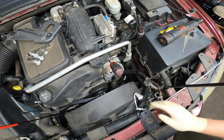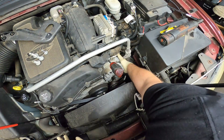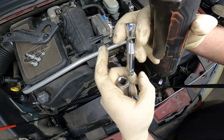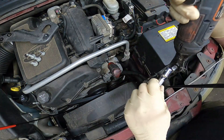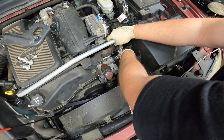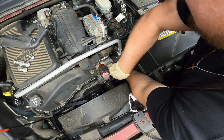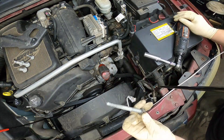My next question is how many bolts are underneath, because it would be pretty cool if it was just one. I think it is just one bolt down below. What I think is going to help me access that lower bolt is this 3-inch extension with a 5-degree swivel head on it — that allows the head to rotate or wiggle just a little bit. Alright, lower bolt removed.